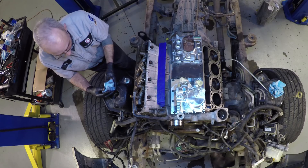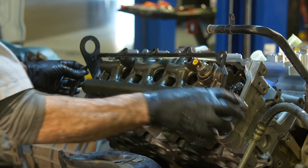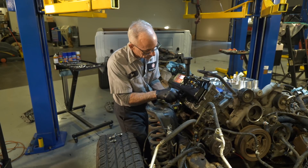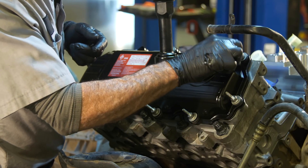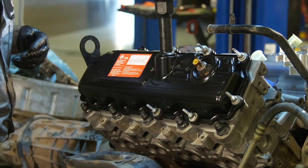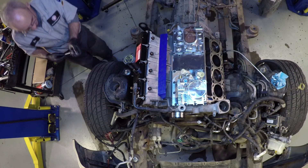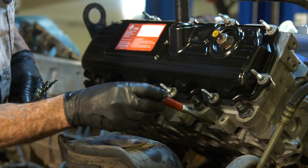Just wiping all the lube off the gasket surface of the rocker carrier. Up next, we're going to put the valve cover and gasket on. That's the final step — getting the valve cover on this side. Hopefully you paid attention during the teardown to where these studded bolts go. For the glow plug hold-down, these all have to be studded for the glow plug module. I always double check them by hand just to make sure. Installing the glow plugs, I use an old spark plug boot starter to get them in — it works pretty good.